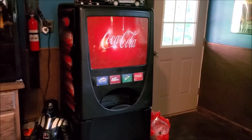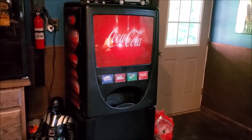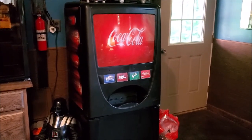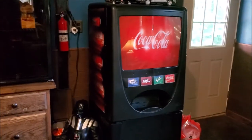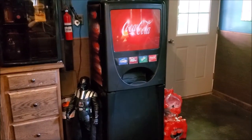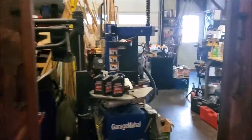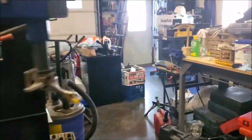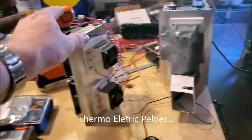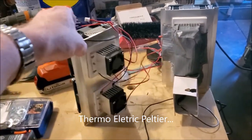Okay, Brian from GarageBall. Giving a quick update on my Maytag Skybox vending machine. These things were pretty popular, probably about 10 years ago or more. The biggest problem was the compressor would go on these things. After transplanting a compressor from this micro fridge — sorry about the mess, we've got a lot of projects going on — it failed after a couple of weeks. So back to the drawing board. However, I started looking at a solid-state design of possibly cooling.